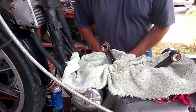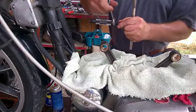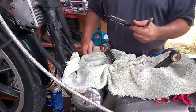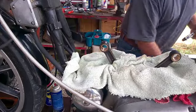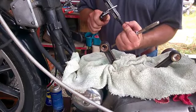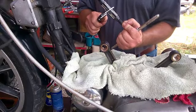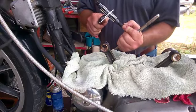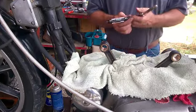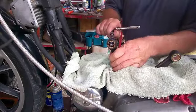So what we'll do here — take your tool, back it off a little bit, tighten it up. I'm going to check the specs on the tool just to make sure. I don't want to take off too much. I got 0.787, so that'd be alright to cut that out and do the final for the 0.791.